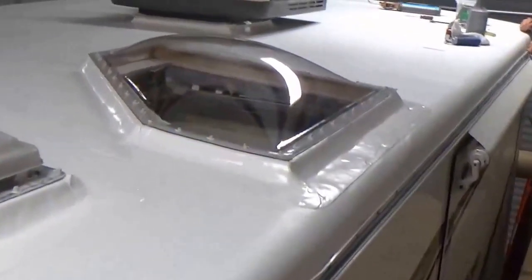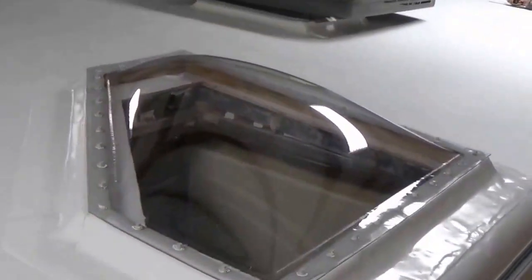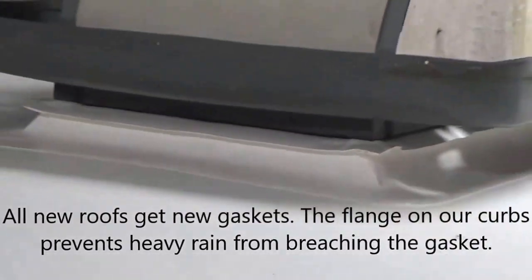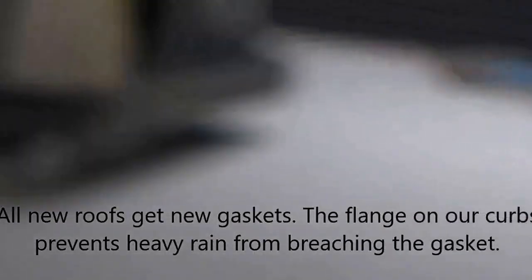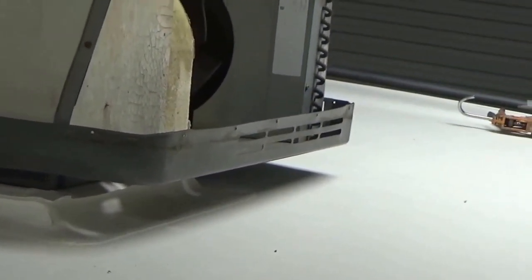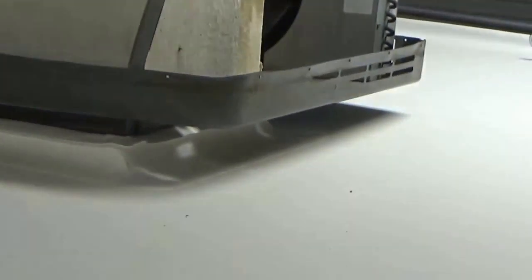You see, we even made this custom curb for this skylight here. Again, all welded in there. You can see the flanges up underneath there. We still got a flashing detail, a counter flash piece, that'll protect that gasket up underneath there. Now on the sides, it'll roll over. See how much the sides hang? The sides hang over enough where the water won't get in that way. We're just really concerned about the front because it's a lot closer. And then right here you can see we've got our stands that we fabricated and put in there as well.